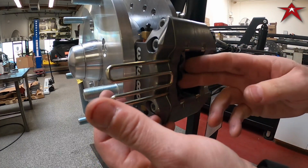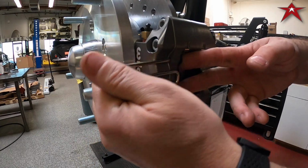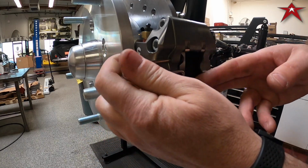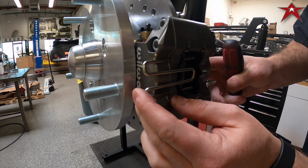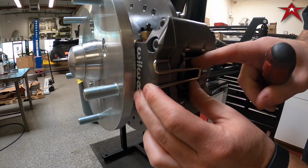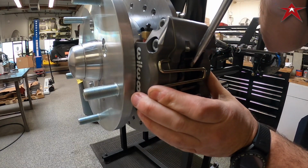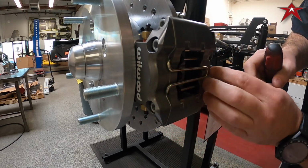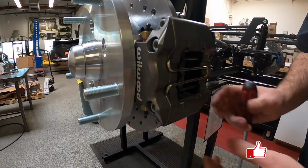Screwdriver anymore. And I like putting my 2 fingers here and pushing it in, and then you're just going to lift up on the back of this to get it over the hump. The hump is going to be on your pad itself. Kind of twist the screwdriver like this, and it kind of lifts it, pops over, and then spread your pads out. Good to go.